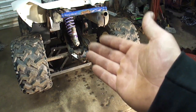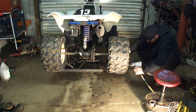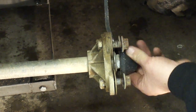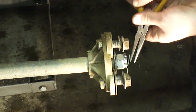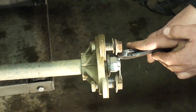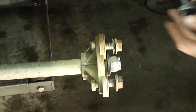After you've destroyed that nut getting it loose, while you're waiting on it to cool, go ahead and pull your tires off and work on getting this hub off. Side cutters usually work pretty good getting these cotter pins. Get that side as straight as you can, then clip it and use it as a lever and pull it out like this.